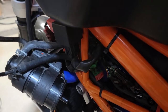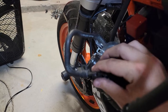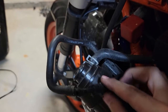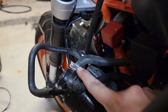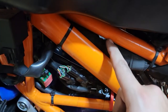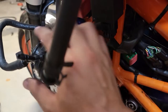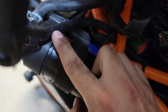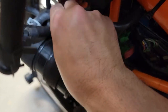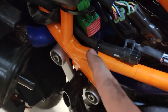This line that I capped actually went to this Y-fitting here. This is the canister — you have this line here which goes in through here and it goes to the purge valve. There's also a bottom vent, and this hose here is basically a blanked-off hose right here.